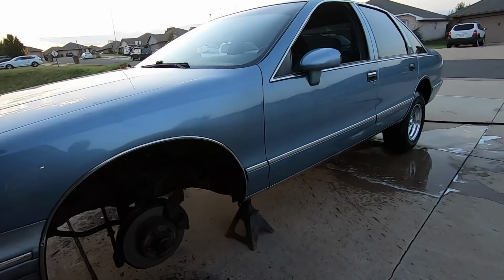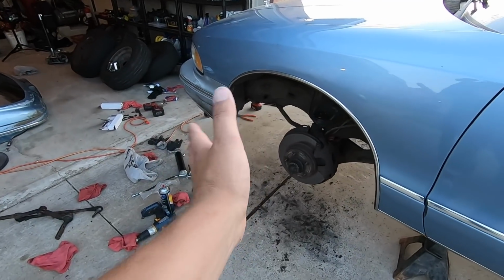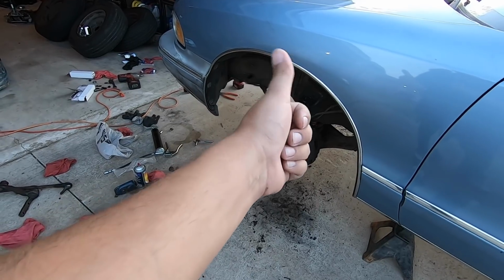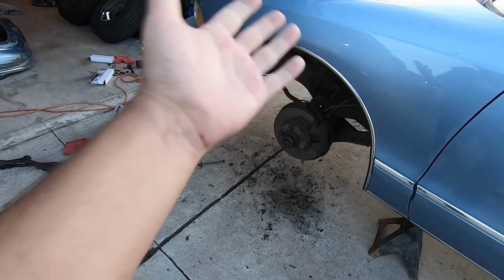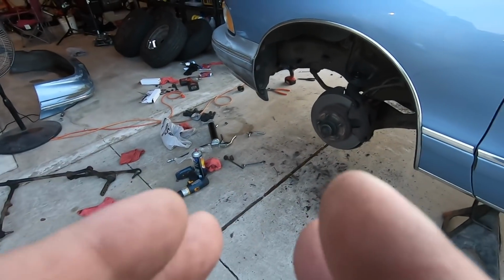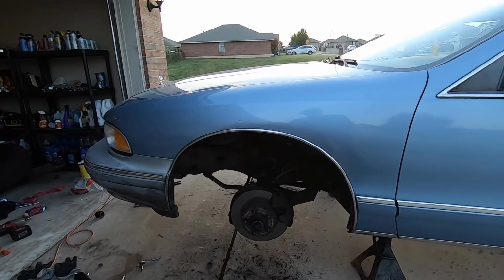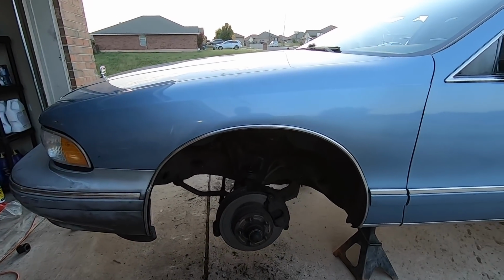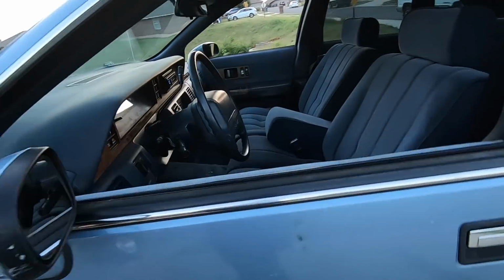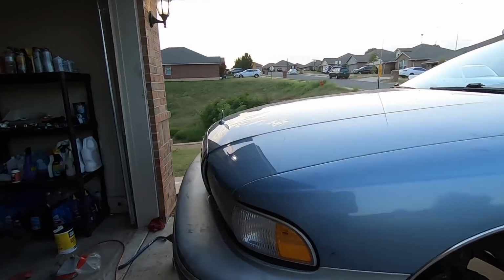Unbelievable the amount of issues that got run into. One thing I noticed is this wheel was a long way in that way, and the other wheel on that side was facing this way. So the wheels were going to be like this. You know what I mean? That ain't good for these brand new tires. So I adjusted the tie rods till I got everything to look straight. That's basically an eyeball alignment. I think it's going to be all right. The steering wheel is straight. The wheels are pretty much straight. We've got to get this in tomorrow for an alignment, like immediately.